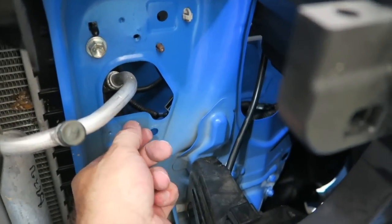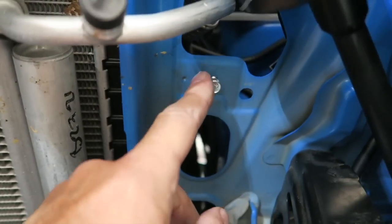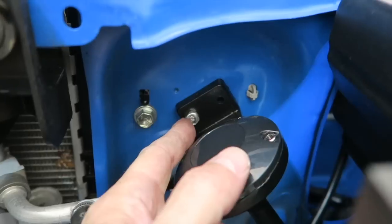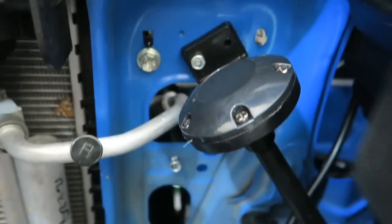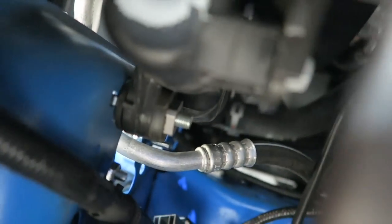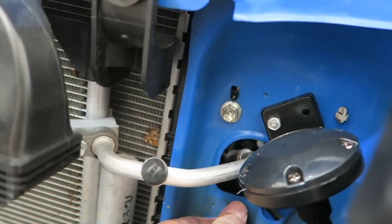I'm going to connect it all up on the other side of the front of the truck, including my wiring for the momentary switch. First things first, got to get the horn mounted in here. I'm going to stick it down through this slot and bolt it through one of these two holes — haven't decided which one yet. Got it screwed in and bolted in. Conveniently, there is a threaded hole that matches up with the hardware that comes with the kit, so I was able to just screw this screw in through one of these holes. Down there you can see there's plenty of room — it does sit close to the lighting fixture, but not right on top of it. You can also put a bolt on the other side just to secure it up.